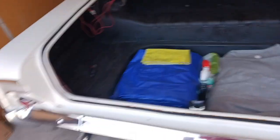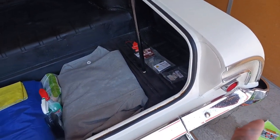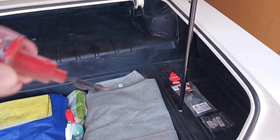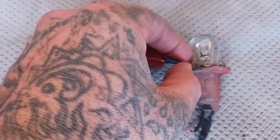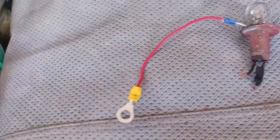I had a problem though. I got all my lights working, everything was working, my running lights were on, but when I would step on the brake, the right passenger-side running light would go off, and when I released it, it would come back on — but there was no brake light. I couldn't figure it out, but it was just a bad ground; the housing wasn't grounding it. So I made a jumper — I filed the connector down so it bends over, then I grinded it down to bare metal and bolted it to the chassis. Now it works perfectly fine.